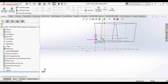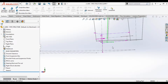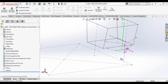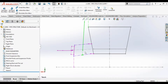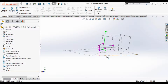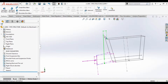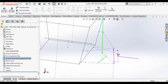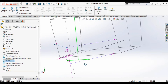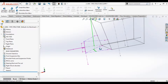Now let's come to the video. Here we are in the SolidWorks software. I already have the suspension geometry with some base parameters like track width, ground clearance, and wheelbase. I have a front suspension box showing a double wishbone suspension with an upper A-arm and a lower control arm. I have also mounted a shock absorber — one mount is on the body as the upper mount and one mount is on the lower control arm.